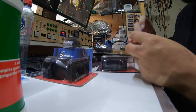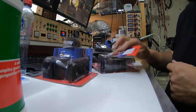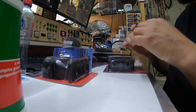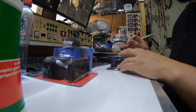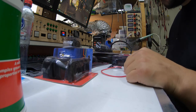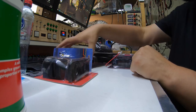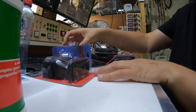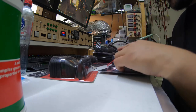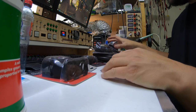We have a big fuse holder here with ANL fuses, and I've got a 250 amp fuse that's going to be our main battery fuse that I've been talking about in previous videos. I've got an inline fuse holder for some 12 volt stuff that doesn't currently have a fuse on it. For what I'm going to call the battery bay - which is above where the batteries are stored - I'm going to put the 24 to 12 volt converter in with that. I've also got some cigarette lighter sockets to install.